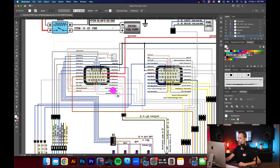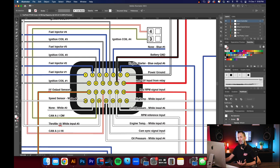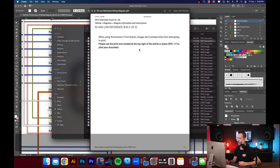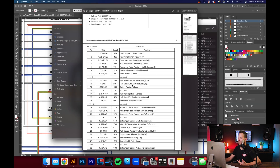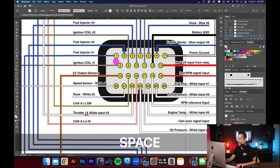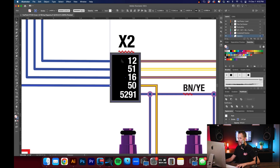I initially brought in the whole setup — the A plug and the B plug — which already had all the labels on each one of the outputs and inputs, so really all I had to do is connect the dots. I did have to find all of my vehicle schematics, such as the ECU pinouts, which I got from alldata.com. The biggest ones we were working with were the pinouts for the ECU. So if we trace back fuel injector number one from our wiring diagram, we trace that back to our connector — I marked it as X2.